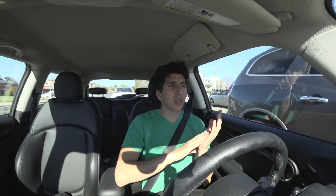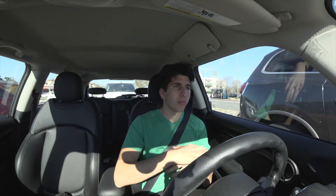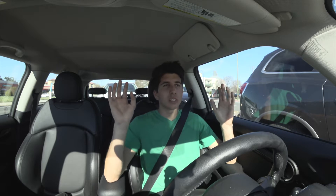The car is just bonkers power now, which is really fun. But I just wanted to give you that warning — the install is super easy, but make sure you have it all done. The other thing is with the tune: this morning I was leaving my house and my car kind of felt like someone heaving really hard trying to catch their breath, or like having an asthma attack. It only does this in reverse, and I think it's just when it's cold — I need to let it warm up for a minute or two in neutral. It got down really low in the idle, like idling at 500, just for a second when I clutched out in reverse. I thought the car was going to die. I think it's just the JB4 throwing things off. So if you're stock and you do this intake install, it should take you maybe half an hour and then you'll be set with an awesome-sounding car.